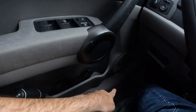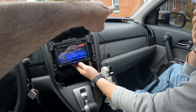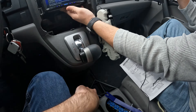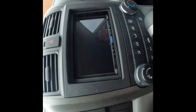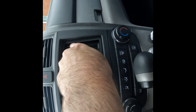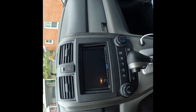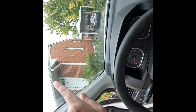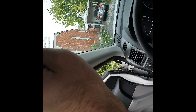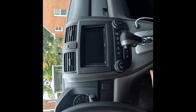So we got the mounting brackets on and we're getting ready to attach them. We had to trim the faceplate to fit because it's for a double DIN or a single DIN, so we had to trim this little bar off. We got our mic run — we're going to put it up there for now, eventually we'll probably run it up here. Chase also has a backup camera, and we found there's one on here. We found the signal but we can't find the power wire, so we may have to run a new power wire to it off the back of here. As easy as this is to take out, we'll spend another day doing that.